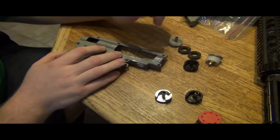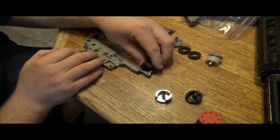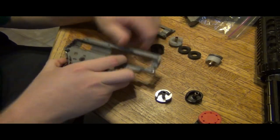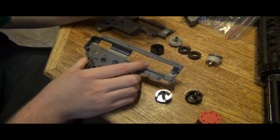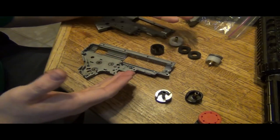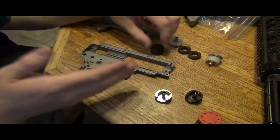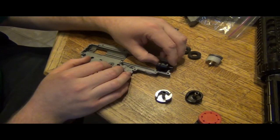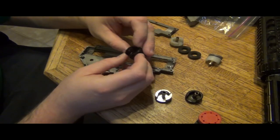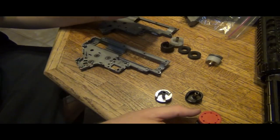It's more prone to crack when the impact is only on the mounds because it's right here towards this area. If this is for sure true — which I'm pretty positive — this could be a modification that could be done: just check your cylinder head and make sure it's touching the front of your gearbox. I'd have to do more builds with different cylinder heads to show the difference between ones that don't hit the front versus drilling out these holes just a tiny bit so they hit the front.